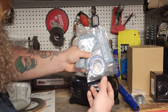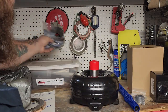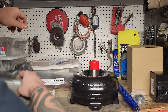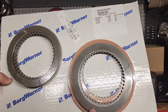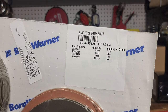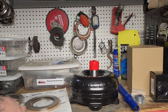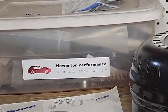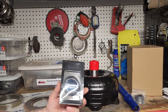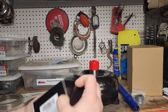We had to get some new Teflon seals for our input shaft, and I got some spares just in case because Teflon seals can be a pain to install. I've got all new Borg Warner high energy frictions — that's what I've always used, they just work great. And then I've got my various transmission parts in this box, spares and a bunch of stuff. The goal is to get this tranny built and hopefully get it in.